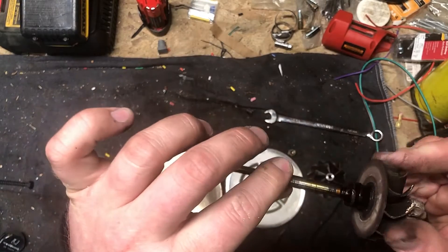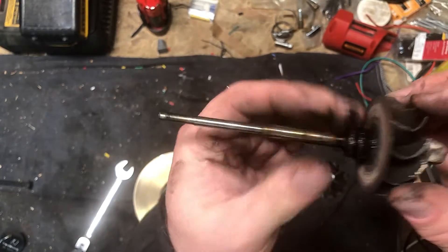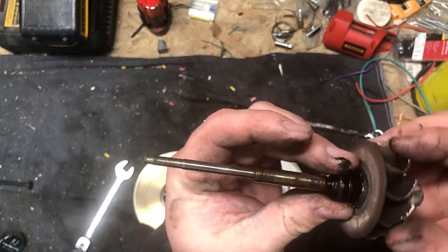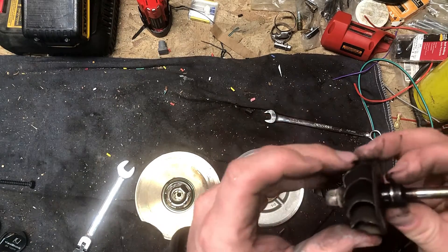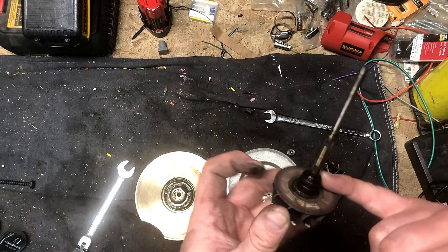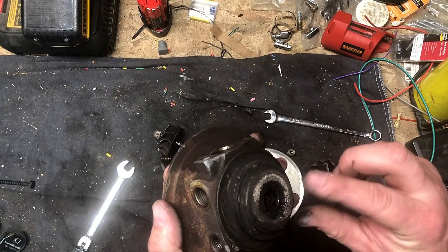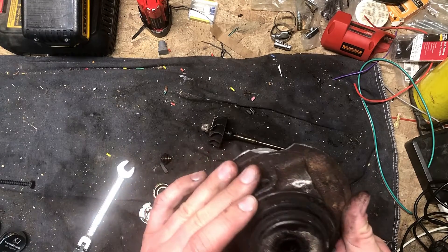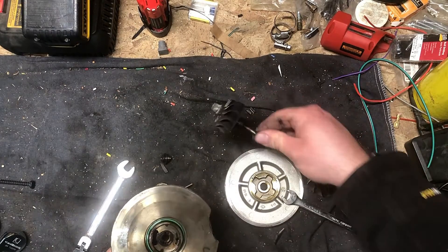So that's the center shaft. You can clearly see wear on there — I don't have my calipers out but you can definitely see that that was fretting a little bit. I would assume that's kind of like cold-start damage because this thing has to receive oil pressure to work. We've got what look to be sealing rings of some sort — they do feel like metal. And you can see any oil that was leaking out here was burning and just leaving carbon deposits. That can't possibly ride on plain bearings... I think it does. I think it just rides on brass bushings in there. That's nuts.